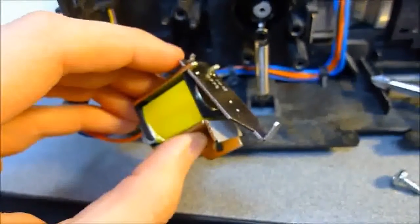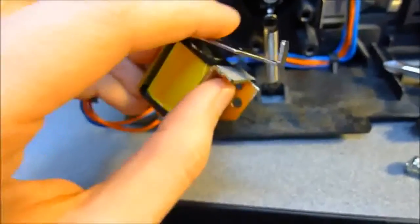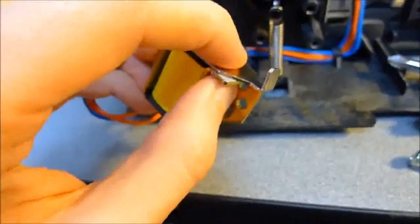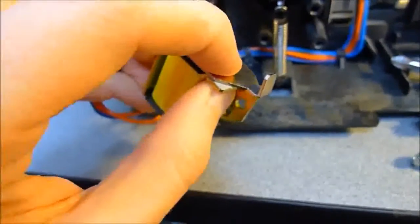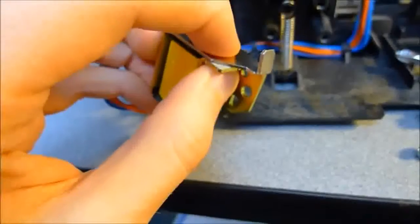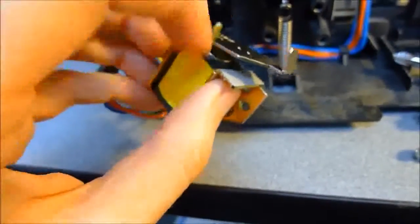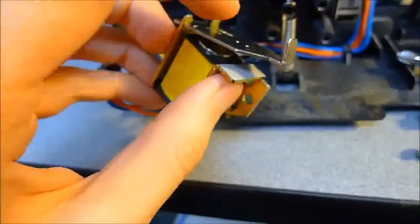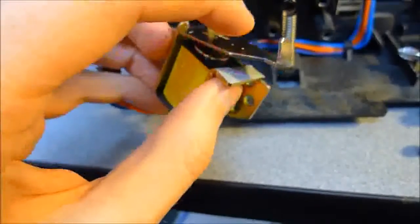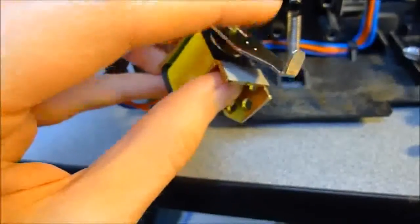Once you've taken care of the other two solenoids for tray 1 and tray 2, right before you put it back on, go ahead and give it a try. You should be able to press on the armature really hard and still not have it stick at all. That should mean that the adhesive, thanks to the little electrical tape I put on there, is not going to pose a problem, and we're not going to have any issues with residual magnetism either.